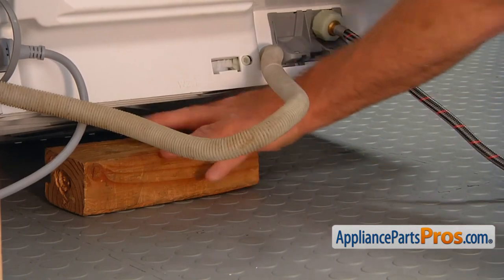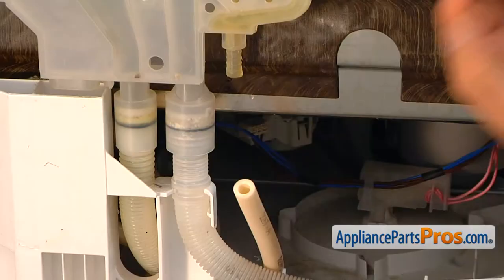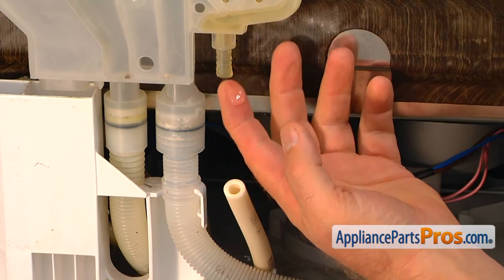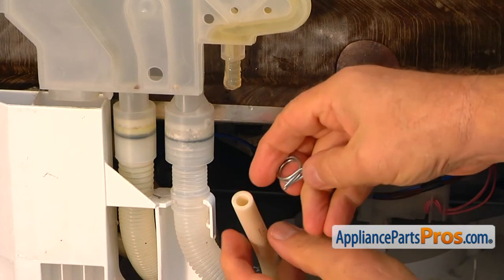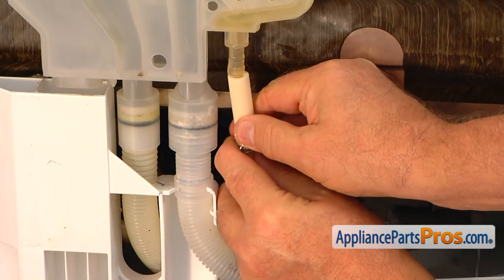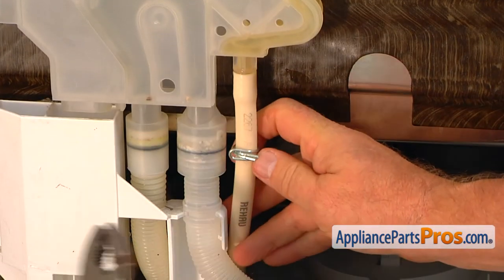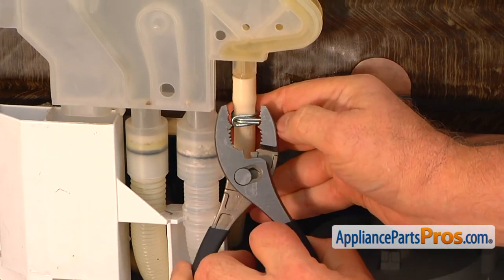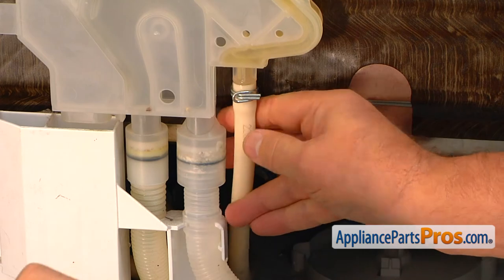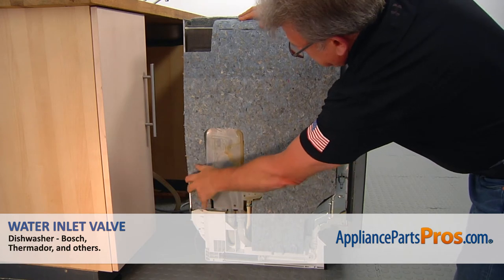It's time to remove the wooden block — lift up the dishwasher, take it out, and place it on the ground. I'm going to put some soap on that connector and install the clamp under the hose. We're going to slide the hose under the water inlet housing, and the clamp goes on next. Use pliers to squeeze it and slide it on. Now we can put the insulation back under these tabs.